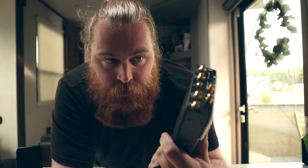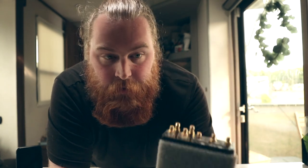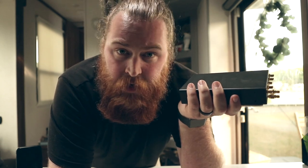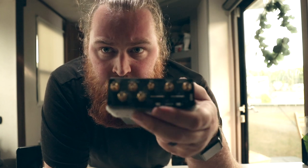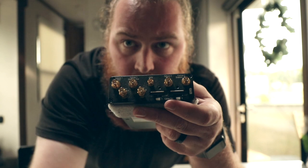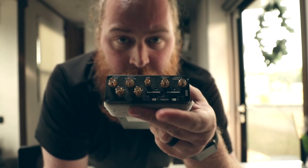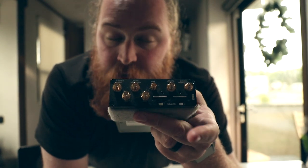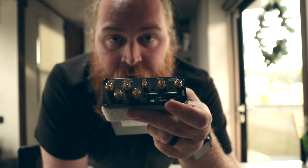In most cases you do not have to unplug or unscrew any of this — I did this just to show you what we're going to do. I have the Transit Duo, but the process is going to be the same whether you went with a Pepwave BR1 Mini or all the way up — it's more or less the same. The main difference is mine has two rows of SIM slots, so I can put two in this modem and two in the next modem. Most of you without a Transit Duo will just have two SIM slots total.